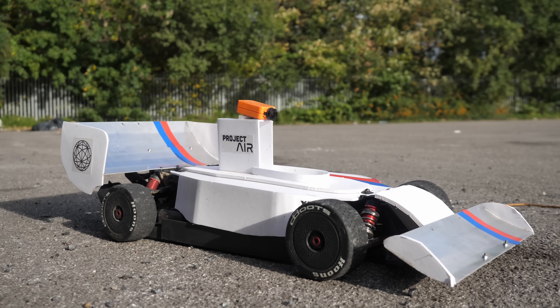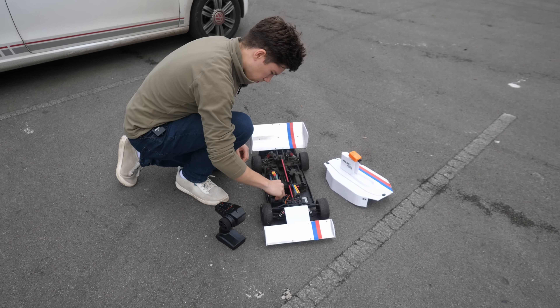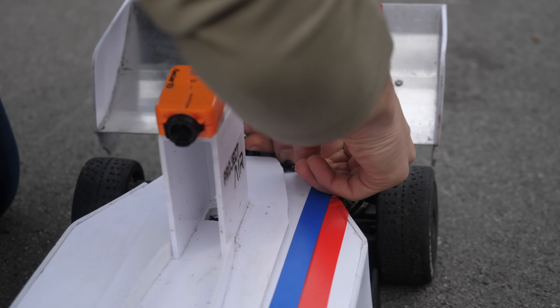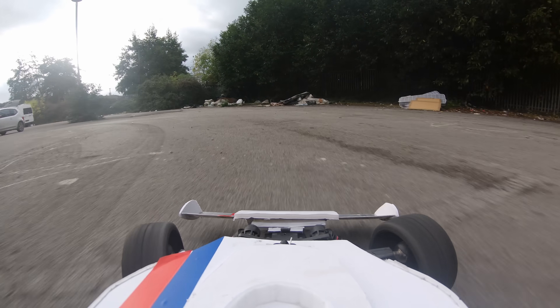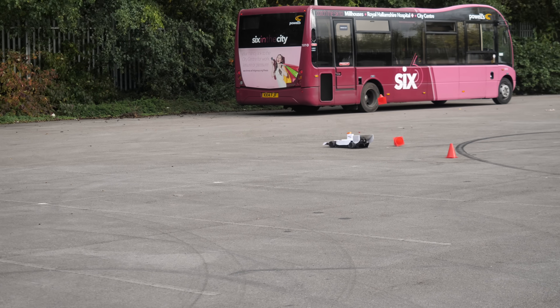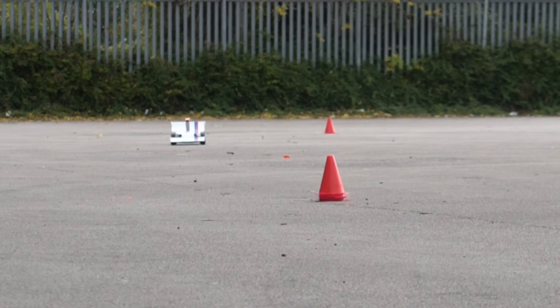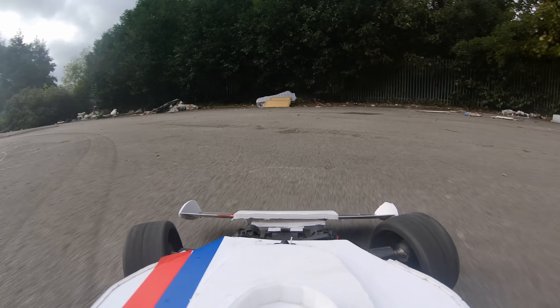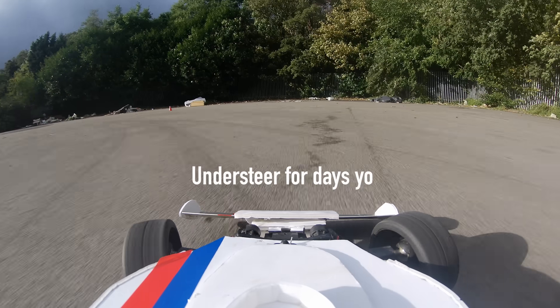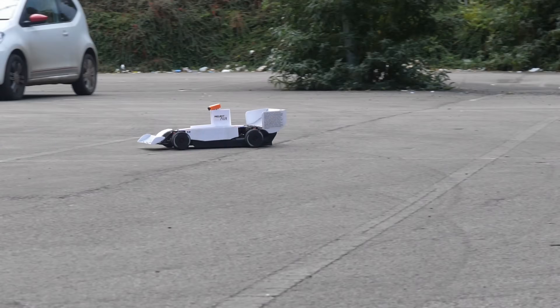I thought I should take the car to a more open and smooth place to attempt some much higher speed cornering. We laid out some cones to go around at max speed and see how much the tyres scrub. Hopefully from the onboard footage we'd get a good idea of the amount of understeer and whether the wings were working at all. At slow speeds there clearly wasn't enough air going over the wings to stop the tyres scrubbing — I needed to be going much faster. At flat-out speed the front tyres were definitely scrubbing and the car was understeering — the wheels turning but the car still traveling straight on, not turning as tightly as it should for that steering input.